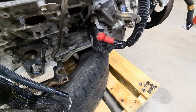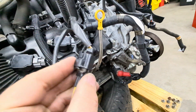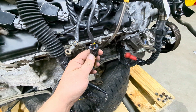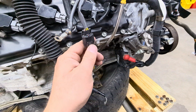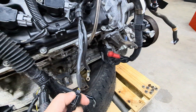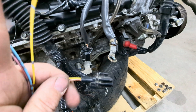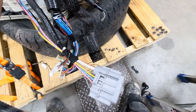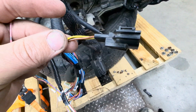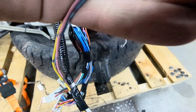For the alternator wires, there are three wires that come off the alternator here that run up through the VK sub-harness and come to this little plug right here. This is going to sit on the side of the fuse box up in the bay, and then these run out and go back into the body harness. I'm going to take this plug, which pops off, and tap those in. There are three wires on it — I'm going to tap those into the three wires for the alternator off of the Xterra plug. On the VK side: pink, yellow, blue. On the Xterra side: brown and white, a yellow, and a yellow and black. I'll check my wiring diagram and figure those out.